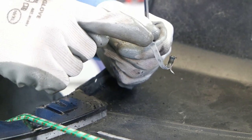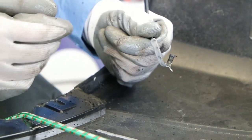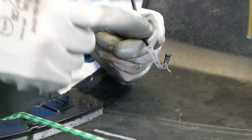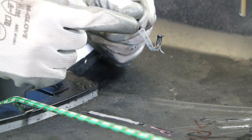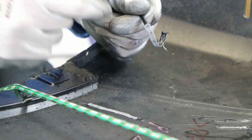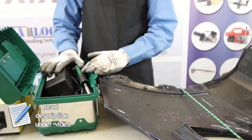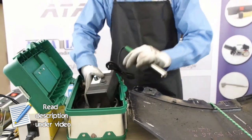It means that there are lots of fillers used here, talc, chalk or others, EPDMs, all used to make it more flexible. If something like this occurs, all you need to do is increase the temperature to 300 or 320 centigrade. If it's still too fragile, then you will need to use glue or UFLEX welding, which I'm going to demonstrate now. Let's see what's in the box.